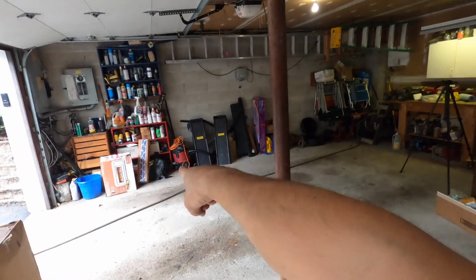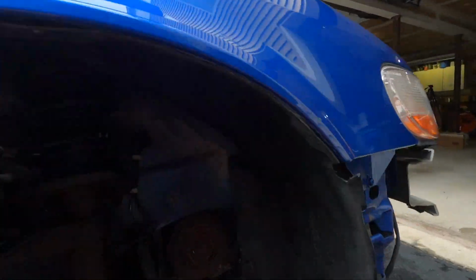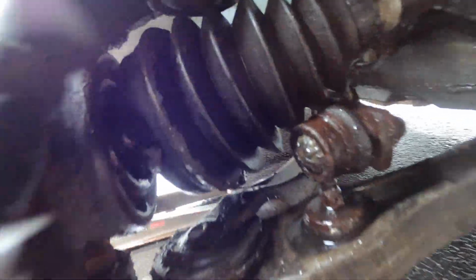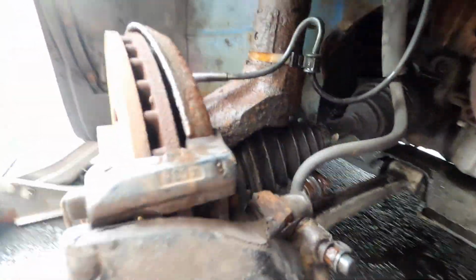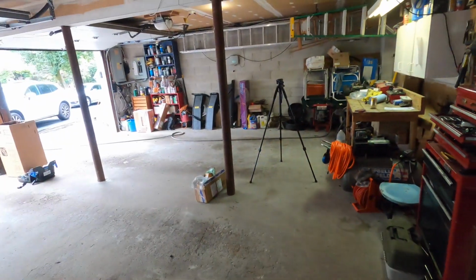So in that box right there on the right, the long box, is the strut cartridges. So we're gonna be doing struts, the shock strut. You guys can see over here, this boot, this rubber here on the control arm looks a bit shot, and the sway bar links are a bit old. This side of the lower control arm looked fine, so I'm leaving it for now unless I find out that it's bad. But in the next video, we're gonna take care of the shocks.